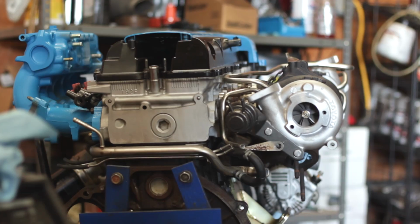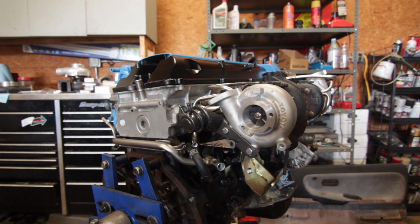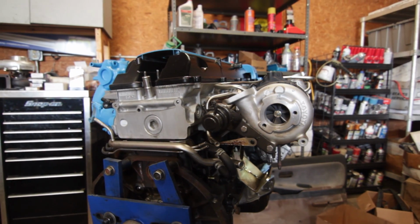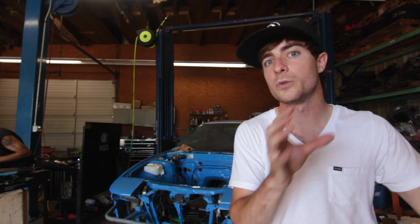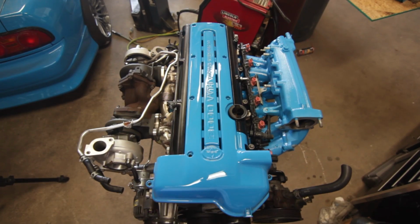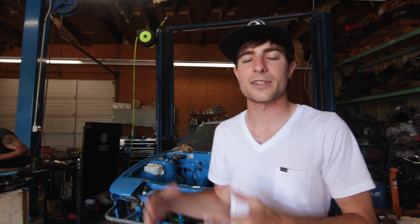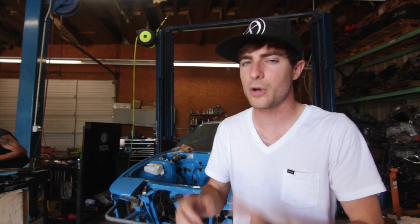The GT28s come from the stock twin turbos, and what you do is you bore them out a little bit and they upgrade everything inside and convert them into Garrett GT28s. So you go from the sequential setup and convert them to true dual, so they both open at once, so it's gonna hit like a ton of bricks. They are nicknamed the Stu Hagen turbochargers because a man named Stu Hagen really pioneered them, and ever since then, not too many people have done it.